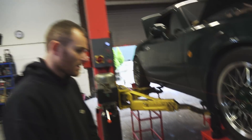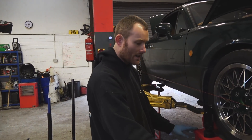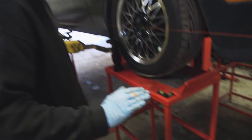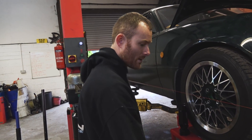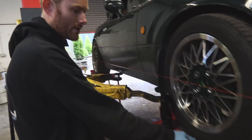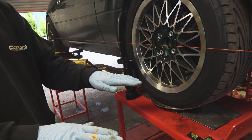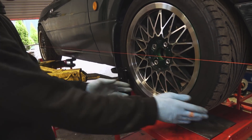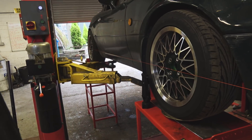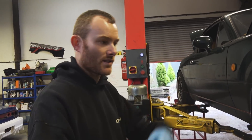Just explain to the audience what these stands are for. So these stands are because we're using a two-poster ramp — it just allows us to lower it onto a level surface. All the ramps are actually levelled out; you've got a spirit level bubble on each one so we know the ramp is completely level, so when we do the camber it's reading correctly rather than guesswork. And then you also have these little turn plates on here which sit under the wheel — when you're turning the wheels without these it would grip up, so this gives free movement to turn where it needs to.